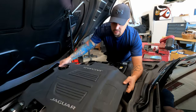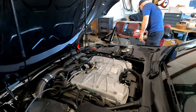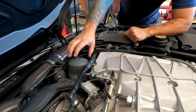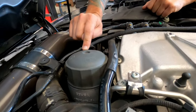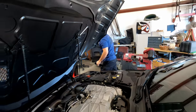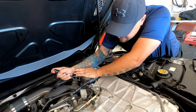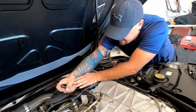Pull the cover straight up — your oil filter is right here on top, so real easy to get to. We're going to grab a tool to get this off. As you can see, it is a Ford Motor Company design because this motor is partially Ford. I use just a regular oil filter wrench, works really well on these. Go ahead and get it centered and get your oil filter broken free until it's loose enough to do by hand.